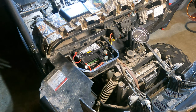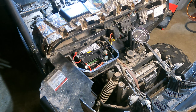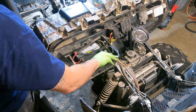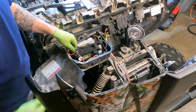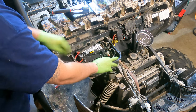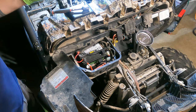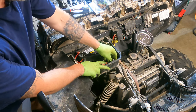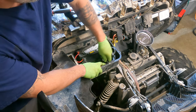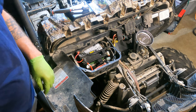I'm going to walk around, turn the key on, see if we get it turned over or not, which I'm pretty sure we will. There you go - boom! Super simple fix on that one, guys. Like I said, it's a very common issue. Starter solenoids going out on these things when you're cranking them and cranking them. Happens to a lot of models, a lot of different brands. I'm going to cover up the nuts and bolts here so we don't let any water or mud or anything get on there, possibly crossing it up and getting 12 volts directly to the starter all the time - we don't want that to happen.